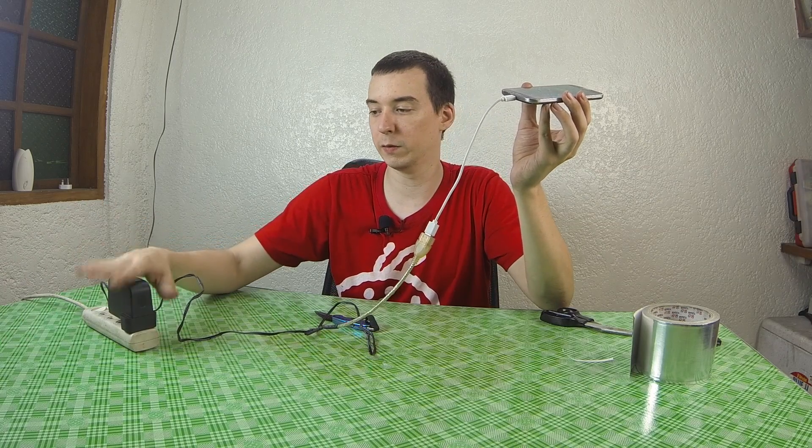This is good for any kind of AC adapter that the phone isn't recognizing correctly, and it's especially useful for car chargers. Pretty much every car charger I've bought, when I plug in my Android phone, it's only pulling 450 or 500mA — really the bare minimum. Just modify a cable like this and it's going to charge much quicker.